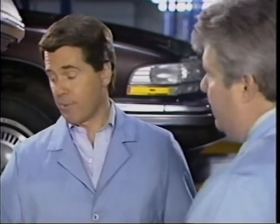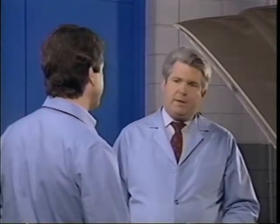When I hooked up the Tech 1 and entered the diagnostic mode, then I got some action. I found three diagnostic trouble codes stored. Oh, and also, I noticed that the anti-lock and traction off lamps in the instrument panel remained lit after I performed my tests. Now you can see why I picked this to be our test car. I guess. So, what's our next step?